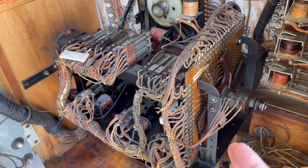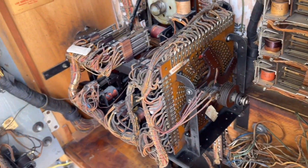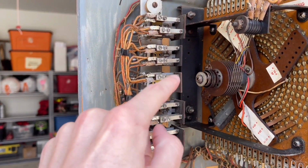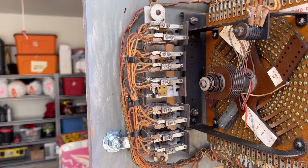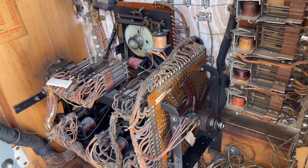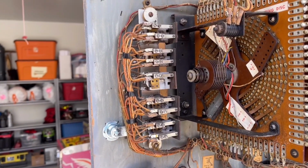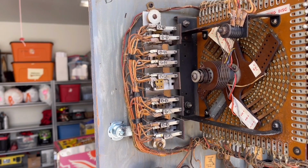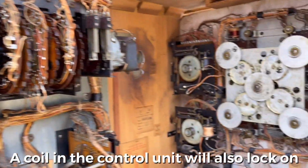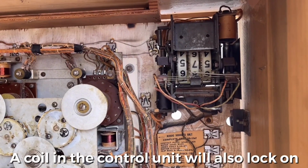So when the game goes about doing its thing, the search disk is rotating constantly, and if you have balls in the holes, these search relays, these are the 5 search relays that you hear clicking, those will start to click, and the search disk is what controls those relays clicking because it is searching, that's why it's called the search disk, using these relays to see if you have a winning combination. And if it finds that you do have one, one of these relays will lock on, and then it will advance the credit counter up here to the correct number of credits.